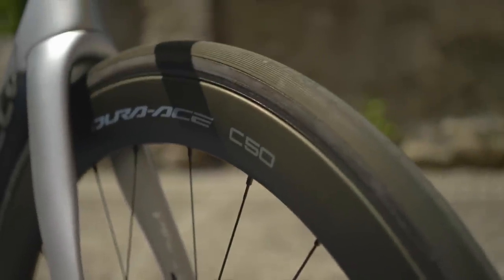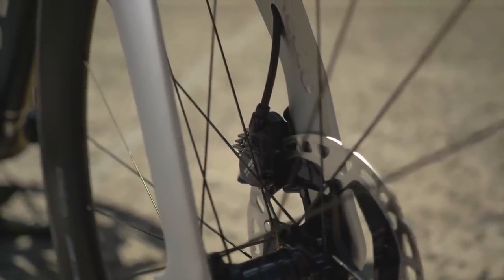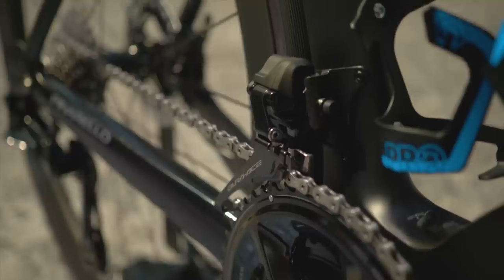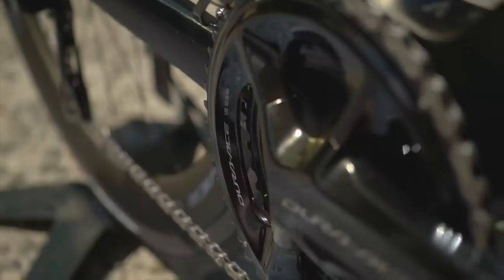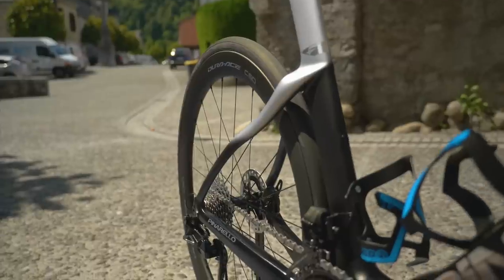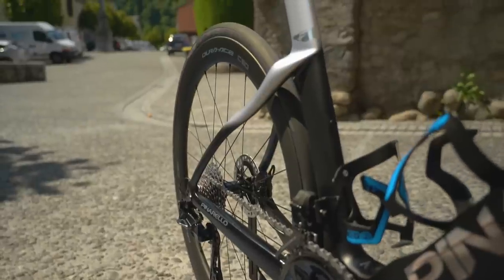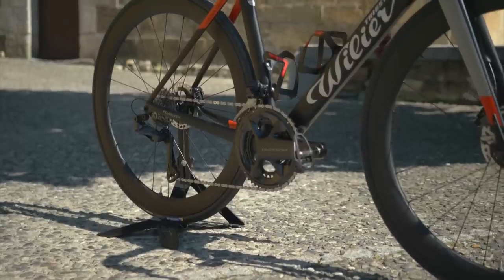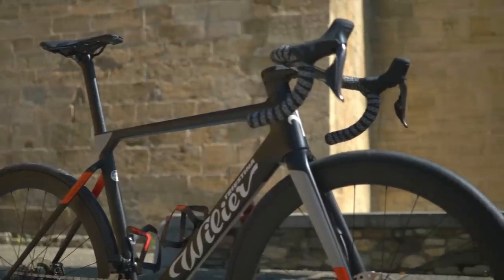Okay, because I noticed the new Dura-Ace has an 11-34 cassette, which is interesting in itself, because in the olden days, 11-25 might be the biggest, and then 11-28. So 11-34, that's almost a gravel setup with a 1x in the front, perhaps that could be a gravel groupset. But again, there you can come into a long discussion, because if you come from road cycling and endurance cycling, there you see that the large majority globally is still on a double setting, whereas if you go towards the more mountain bike replacement and trekking bike replacement, there you see a predominant drive towards a single one. So also there we can make the right products matching the right type of riding.